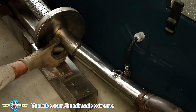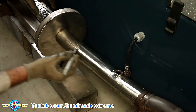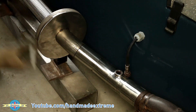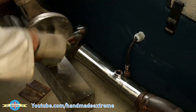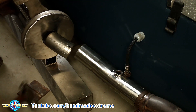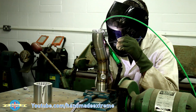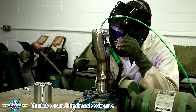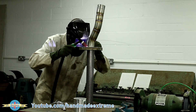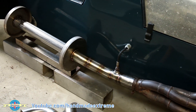I get a measurement for that straight piece, cut it, tack it on and bring all the bits together. Since I've got it all set up nice and level it doesn't roll, so I can put a mark across there and then tap off the piece I've tacked onto the front of the new muffler — turns out the tacks were quite good, took a bit of persuading. I take that off and weld that whole section up with a gas purge on the bench so we don't get any contamination on the inside of the exhaust pipe — a nice smooth inside surface. Then I can weld that onto the new muffler, all offered up for a little test fit.